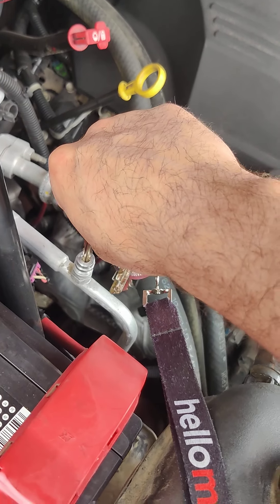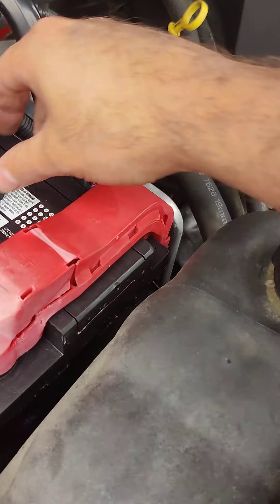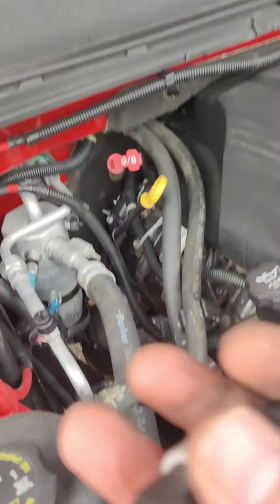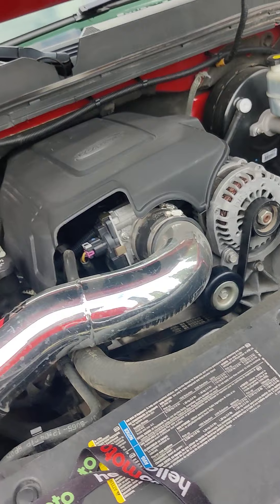Going in this hole you can see I got very little pressure, so that means I'm out of Freon. Also my AC switch is probably bad. I got the switch for about $20 and the Freon for about $25.